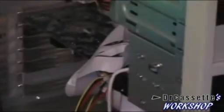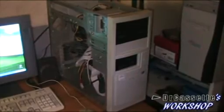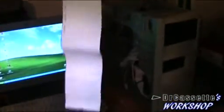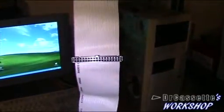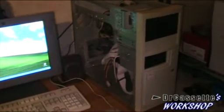I tried different cables — you can see the floppy disk drive cable over there. After a lot of messing around, I found out — and just as a sample, here's another floppy cable — this end plugs into the motherboard, the middle part is for the secondary floppy drive, and down there is the connector for the primary drive. You can see where the cable has been twisted around in a weird way — that part is always for the primary connector. I found out that if I plug the primary floppy disk drive into the secondary connector, it would work. Don't ask me why, but it did.